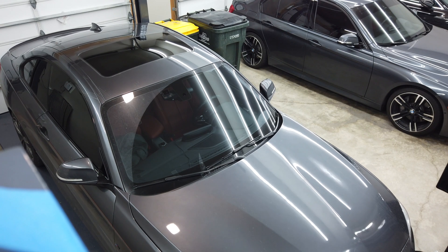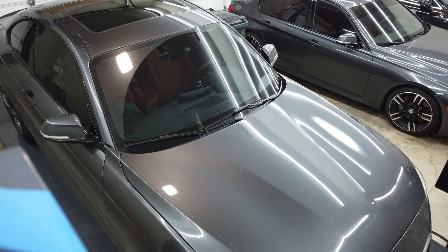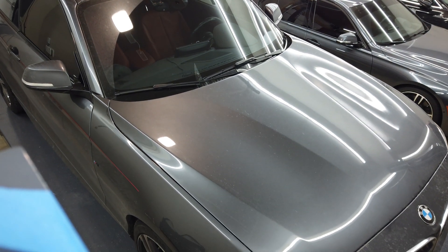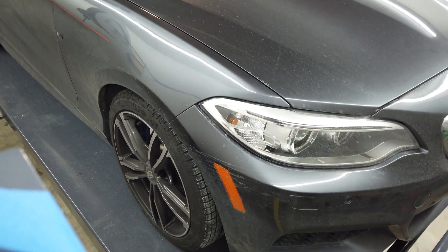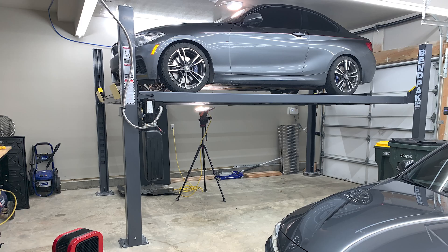Could save a lot of time. First, get your car onto a lift, ramps, or jack stands. The more height you can get, the better. This is because you have to slide the intercooler out from the bottom of the front of your car, and you need some clearance between the bottom of the car and the ground. I used a lift so this is trivial. If you have a friend with a lift, buy some pizza and beer for them and ask for some help — we'll work for pizza and beer.